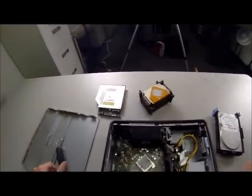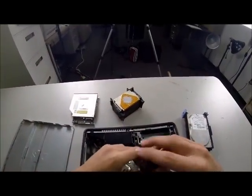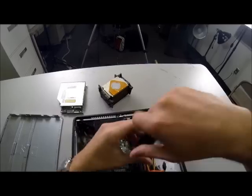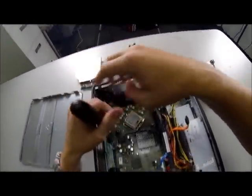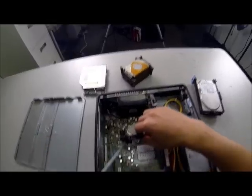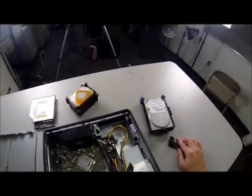Now we can see the meats of the machine — the entire motherboard. Next, we're going to remove the hinge so we can get to the CPU better. Righty-tighty, lefty-loosey — we're doing lefty-loosey. Turn that to the left until it's completely out. Once it is out, lift it up and out. The screws are just at the two corners right underneath the heat sink. Set that off to the side.